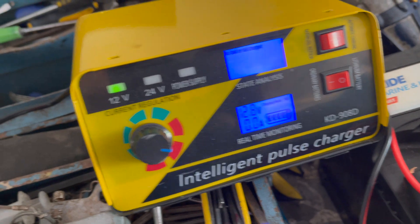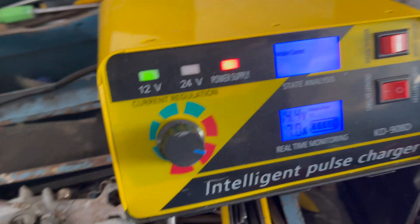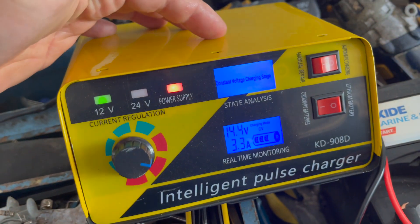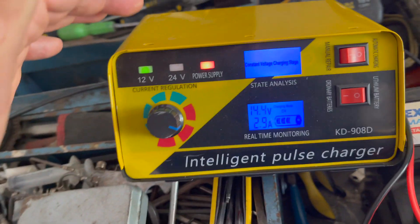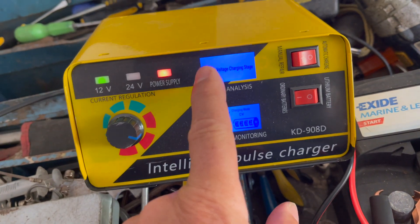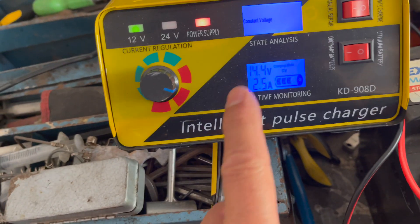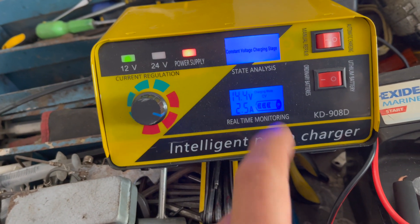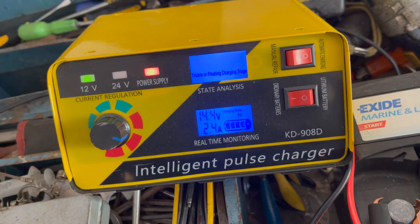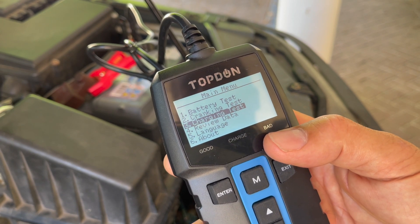It'd be nice if that current reading was more accurate though. It's a bit noisy when it's running — the fan is not very good quality and runs all the time whether it's charging the battery or not. After about six months it did get very noisy initially, though it's not too bad at the moment. It gives you a little status display of what it's doing — it's on constant voltage charging at the moment. The initial stage is variable current charging, and it tells you what current is going into the battery and the voltage on it. It does cut off when it's charged up the battery. Nice little device — I can recommend it. Thanks for watching, and look at the video description for buying links.